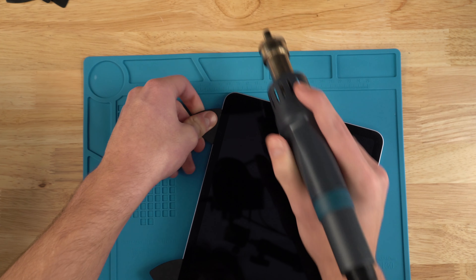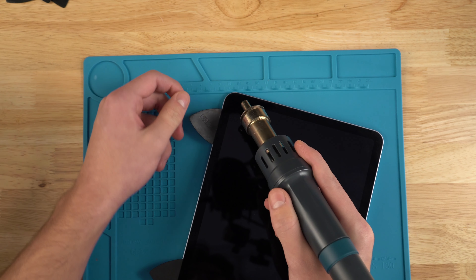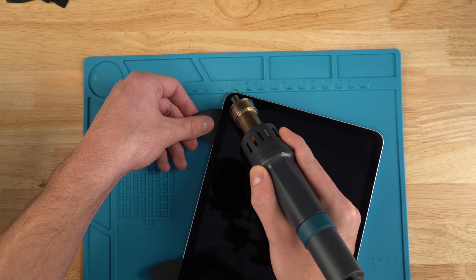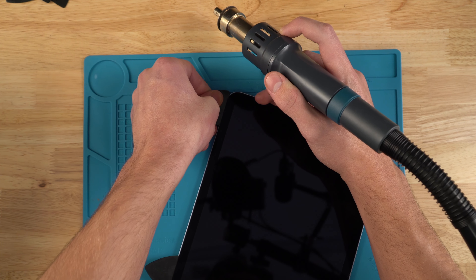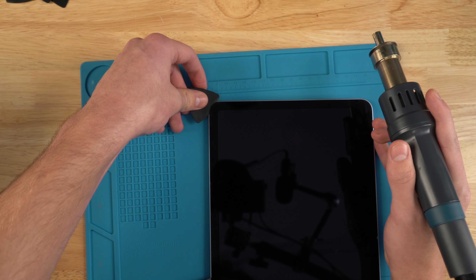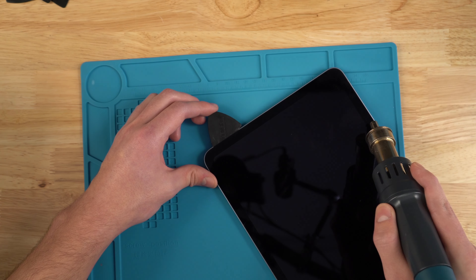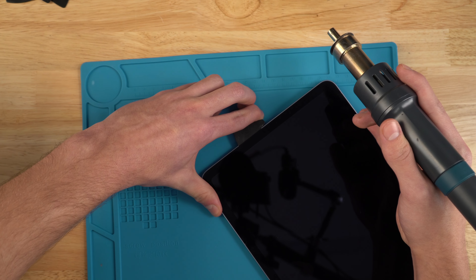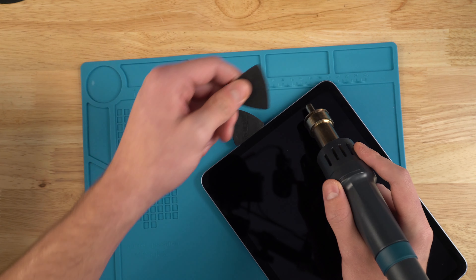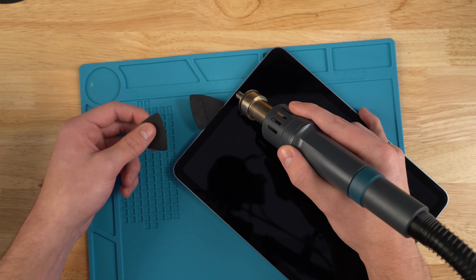As you're approaching corners, treat them almost like a crack in the LCD — be a little more careful and use your heat gun to soften up the adhesive holding the screen down. Don't go in much deeper than this, because you might end up cracking the screen or damaging your LCD further. I typically like to add another spudger towards the bottom of the screen in case I slip again, so I don't have to climb all the way back to the top and can resume where I left off.